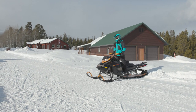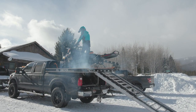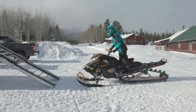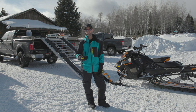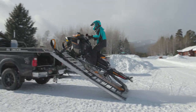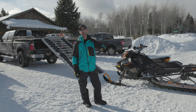The key to loading your sled is to be smooth — create enough momentum that you can almost coast up the ramp. Damage to your belt occurs when you actually come to a stop or slow down and then reapply throttle; it grips the belt and creates slippage. So as I demonstrate, I'll try to be smooth — that's the focus. Always keep your finger on the brake, so as you glide up the ramp you can check your speed when you reach the top.